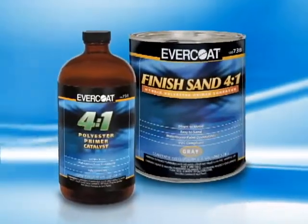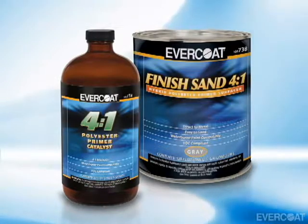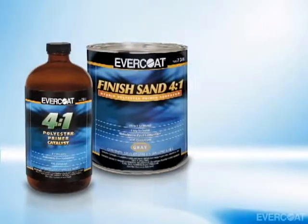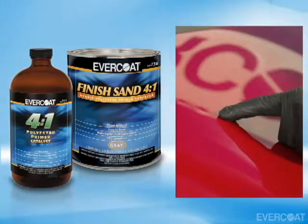Because Finish Sand 4:1 passes the ASTM B117 testing for corrosion protection, it does not require an epoxy or self-etch pre-coat. Because of the high build properties of Finish Sand 4:1, you can even use it for light hail damage and to straighten panels with slight imperfections or waves.